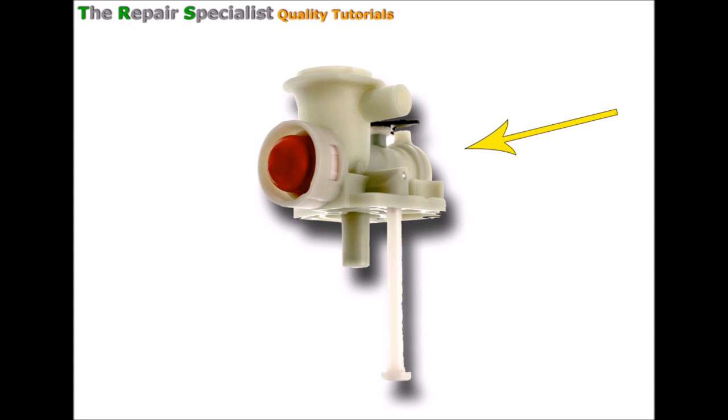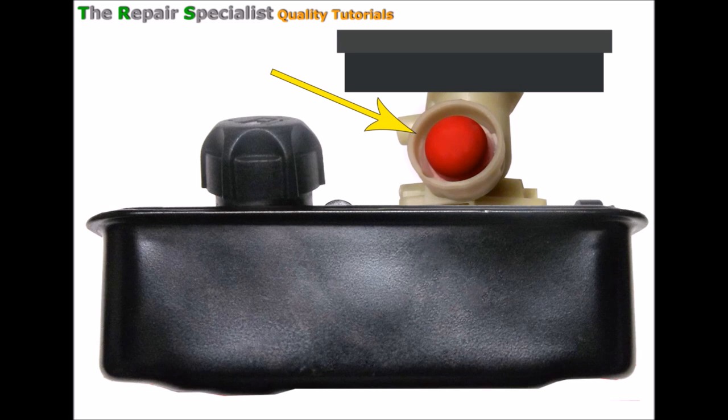That's how it should look on the side of the machine. I've just shown it how when we look at the side of the engine at this carburettor, it should look something like this. We'll have the air box at the top and the fuel tank at the bottom. The air box is attached to the top of the carburettor with a single screw, and the carburettor itself is attached to the fuel tank with a series of little screws, and that's all attached to the engine.